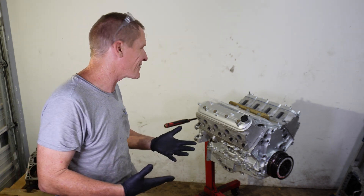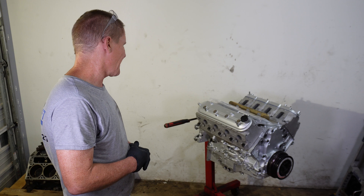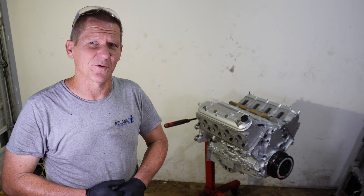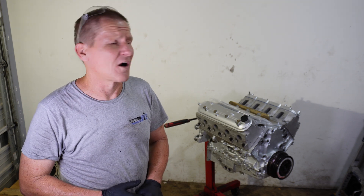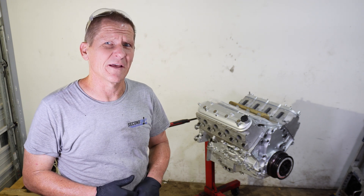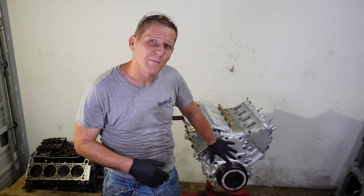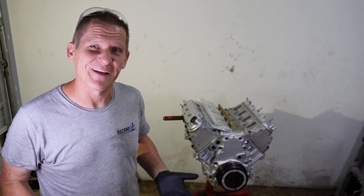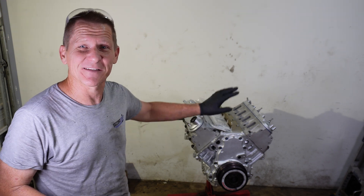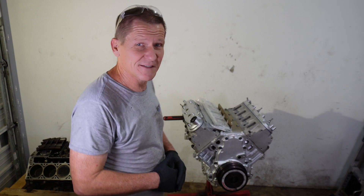Something really cool about this is when we're done, to the naked eye at a first glance when you lift up the hood it will look like an LS7 engine is in there. If you look at the head castings you'll understand real quick it's not LS7 — the casting numbers are 823, and the 823 castings are used not just for L9H or L92 but also for LS3. And on the front of the block, if you were to remove the water pump you might see where it says 6.2 liter. Anyone who runs the casting numbers and sees a 6.2 with 823 heads would really just think this was the ultra-rare dry-sump LS3, which while that's less than the LS7, it's still not as bad as running a truck motor in your Z06.